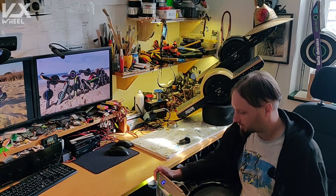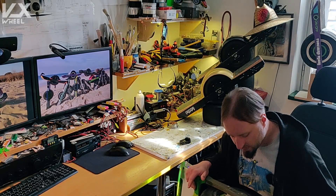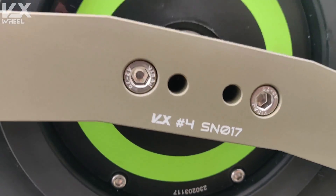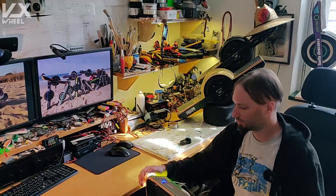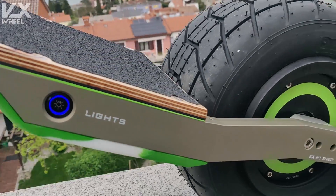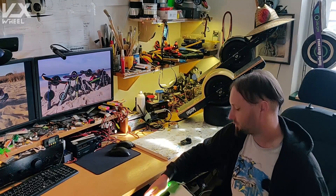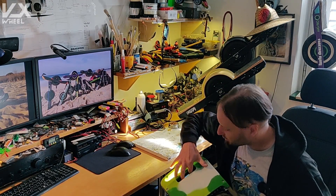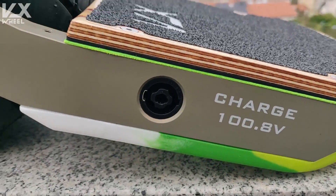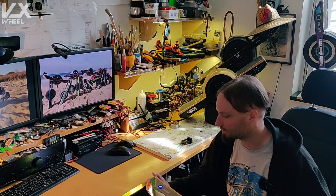If you're familiar with the VXWheel design, this isn't that much of a change. What is new is custom rails and custom boxes that are now all aluminum made — which of course makes this design way more expensive, but this is how it goes. Two switches: one on/off switch, and on the other side a light switch. I used to have the light switch in the handle, but now with the milled box there's no easy way to make a switch hole there, so I put the switch here. The battery display is still in the handle, which is a nice VXWheel feature. The charging port is in the back because there was more free space there, and because the bigger part of the battery and the BMS are in the back.